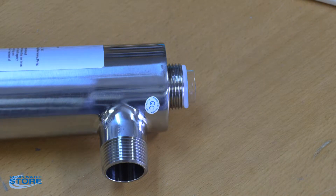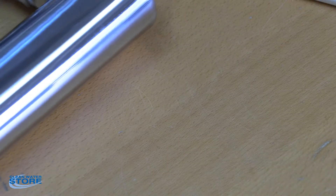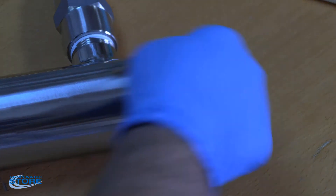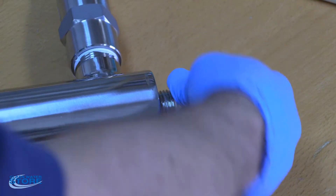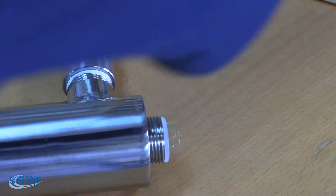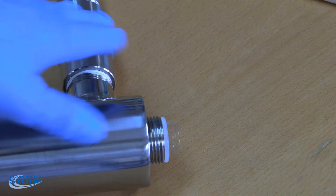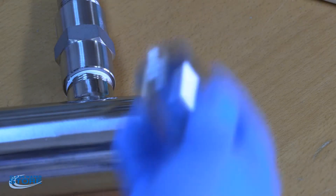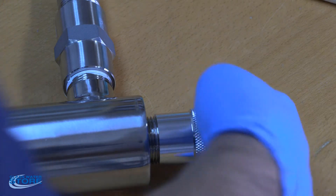You've got your o-ring on that end — carefully slide it around and put your o-ring on the other end, with about the same amount on each side. This is our inlet end that has our flow restrictor on it, so we're going to place the fitting for the power supply. These seal up against the o-ring — this is what holds your water in. No lube required, no thread tape — just put it on hand tight and snug that up.